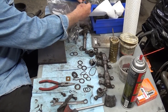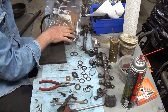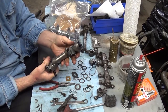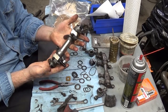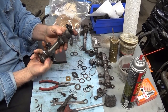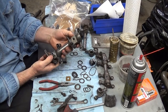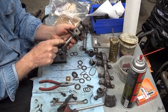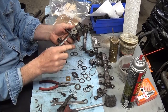Here's an example of some aftermarket 1.25 ratio rockers. These are MP jobs, and it comes with a lot bigger shaft. It comes completely assembled like this. You don't have to get goofy. One of the ways they get the offset, that 1.25 ratio, is by offsetting the hole in a larger shaft. It moves it over, and that's what you're doing.